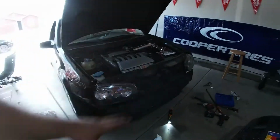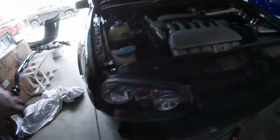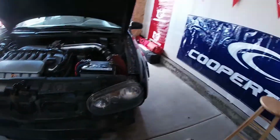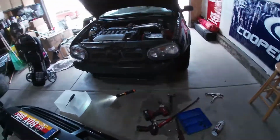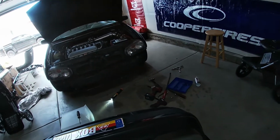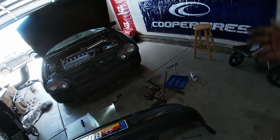As far as this goes, we closed that. Fender gap's supposed to be probably a little bit more than that, and it's almost there. I could probably just beat the fender in and it would be fine, but we had to do some straightening. We were missing a bunch of bolts because this other core support didn't have that whole lower section, so it was missing all the freaking bolts. So we ran out. All we got left is some bumper bolts and the grill bolts. And that's it. So we're gonna throw it all back together.